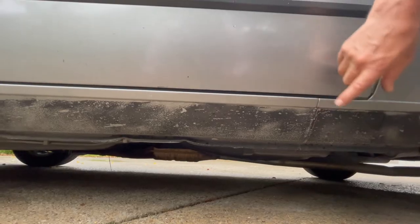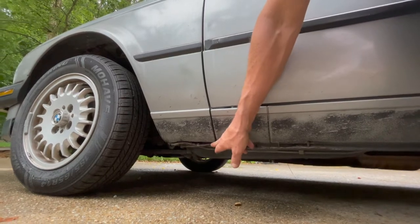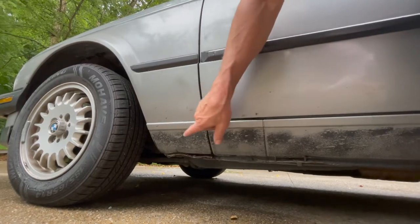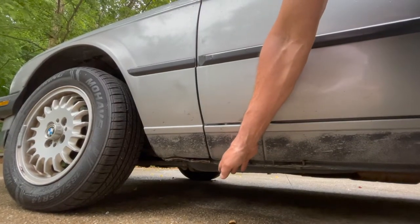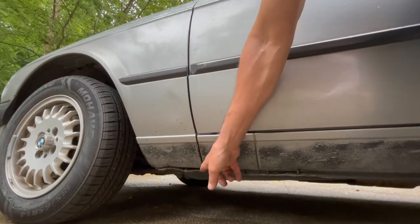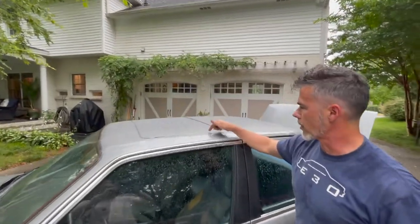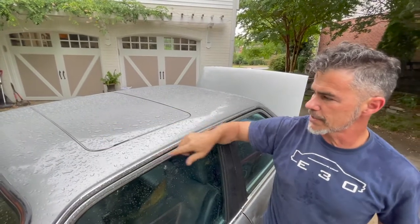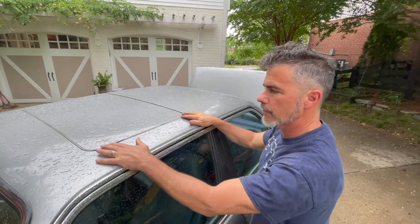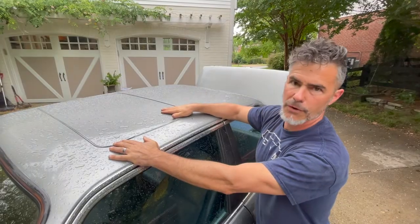Another spot to check on all E30s is the entire rocker right here. You'll see the seam joint from the factory where the quarter panel meets the rest of the rocker — this little bit of undercoating coming off is actually not rust. The fenders are notorious for rusting right here. People have a tendency to jack the car at the fender seam, but there are two frame rails underneath the front of the car — the jack point is another 10 inches in. You jack the car on the frame rail, not the bottom of the fender. One other spot is the sunroof — it's mounted by three hex screws on both sides and tends to rust there a bit. You can replace the sunroof seal for about $138.